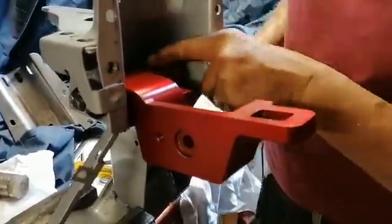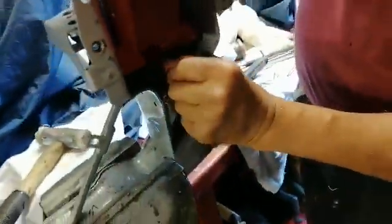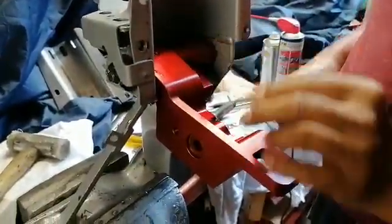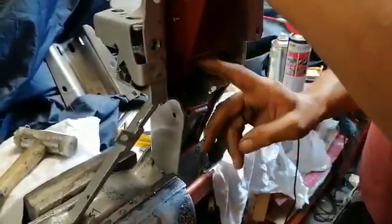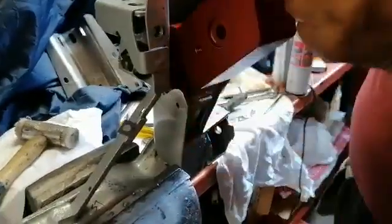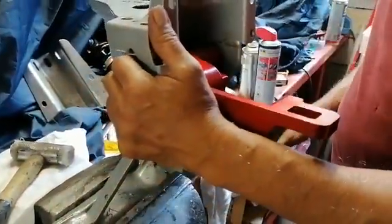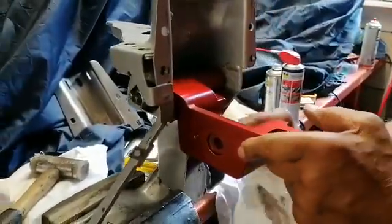Okay so that's tightened up. You can see this other O-ring which has been sat here - just an additional seal to help keep debris out of that washer. Just make sure that's gone into that joint nicely. That's just an additional seal just keeping debris out. So that's the top arm installed. Tighten the pivot bolt up in accordance with the factory specifications, which will be with all the instructions I send.